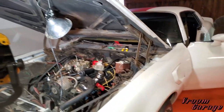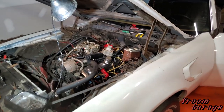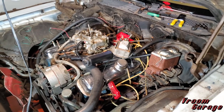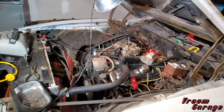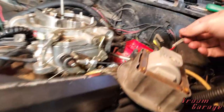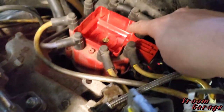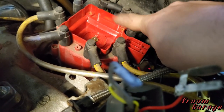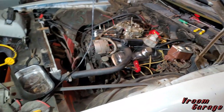Yesterday I attempted to set the timing and screwed something up. We know for sure I was out of gas — that's fixed, got about a quarter tank now. The Accel Super Coil had a bunch of issues, so I'm working on rectifying that. Did not have the HEI pigtail, so that is now in place. The blades weren't properly attached, so I soldered those in. The ground strap goes to the coil and wraps around to a centerpiece — that's where the ground strap touches the coil. We're going to get things cleaned up and hopefully get ignition again so we can actually start the car and maybe drive today.